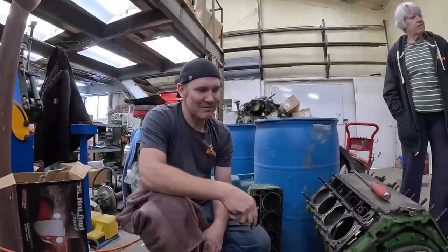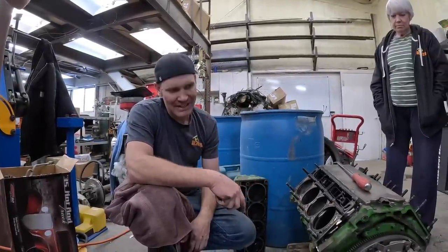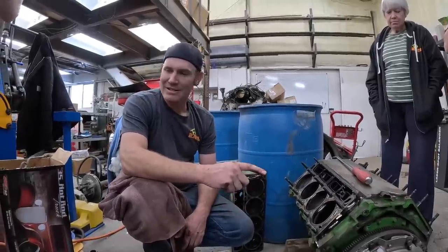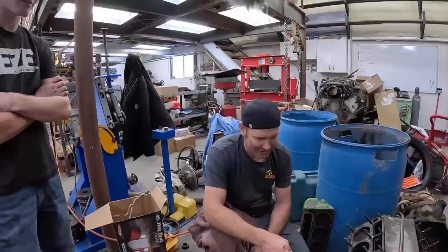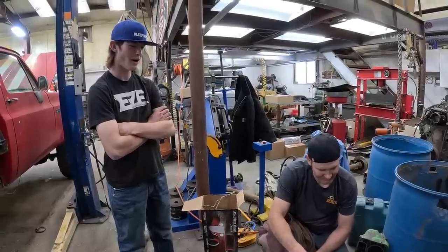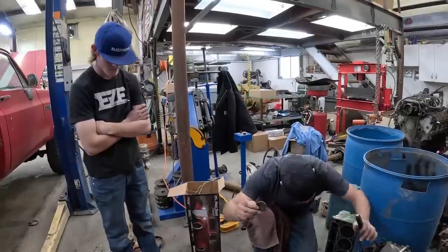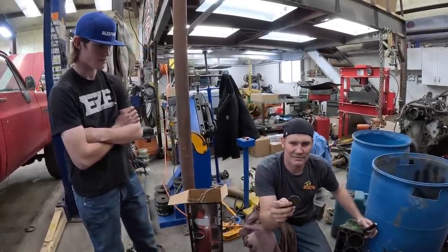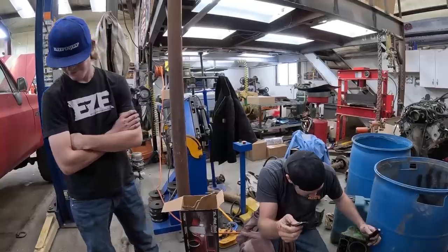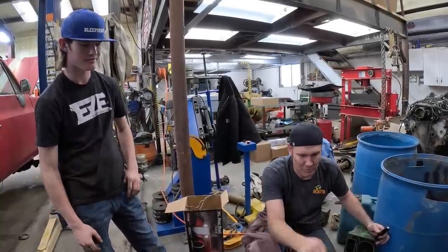Well, there you have it. It dropped a valve, which is a catastrophic failure. Technically, maybe not Landon's lead foot all the way. Be honest now. At lunchtime before, it saw a lot of RPMs. Like twice. More than likely when you have a valve that's broke off like this, normally it's an exhaust valve that causes the problem. But this intake valve evidently kissed the top of the piston, which broke it off and then threw the motor.